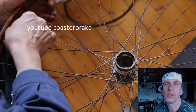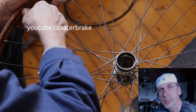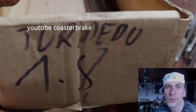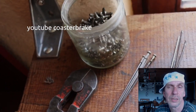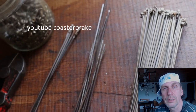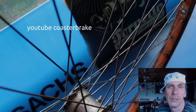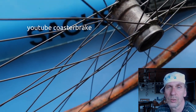This work shows how I draw every nipple of the 36 spokes with the same power. I used 1.8mm spokes. At the left side you can see second-hand spokes, in the middle the broken one, and at the right 300mm nickel-plated new spokes. This shows the result — all bad spokes are replaced.